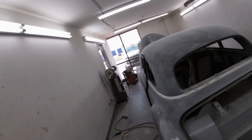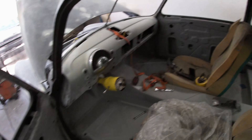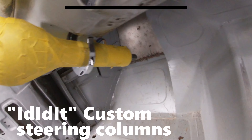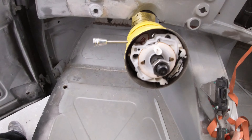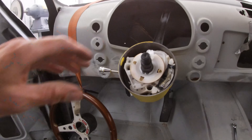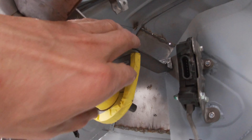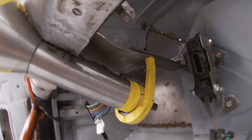Greetings. This is what I'm working on right now — it's a '49 Olds. I'm going to be making all of this work. Just started mounting this steering column, this little guy. Got to mount that, a brake pedal assembly, and the seats, and just make it all work. So we remade the bottom of the dash, this section right here, and I'll show you why. It all fits flush in there. Got this little plate right here to hold the bottom of the steering column, and this right here just to stiffen it up.